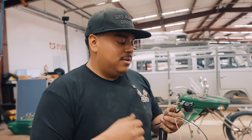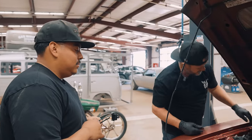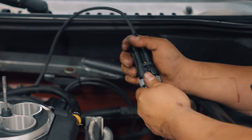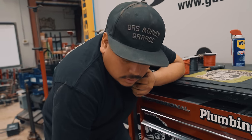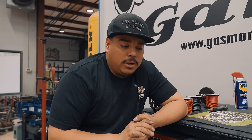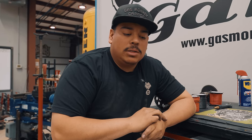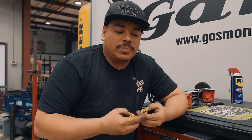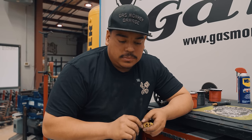I'm going to throw the battery back in there — we threw out five to fifteen pounds earlier, and we're going to add three pounds back. When I took out the stock EFI harness it was like 35 pounds, man. I'm also looking for some fittings we could use for the stock fuel system — something we can rig up because we don't have the correct fittings to go from his fuel lines to AN lines to go directly to the Sniper. I'm going to look for some barbs. The Sniper side already has AN lines built in, but I don't know if this size will work for the hose, so I'm just scavenging through what we've got.